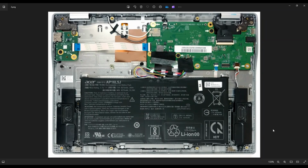Also, before I touch anything in a computer, I'm going to remove or at least unplug the battery to make it safer to work on. I'll show you how to do that now. So to get your battery out here, there's a screw hole here and a screw hole here. I imagine most of you will have screws there. I didn't have any in my computer, so this must have been opened up prior, but there are 2 screw holes on either side. After that, your battery wires come out here, they run through here and plug into the motherboard there. It's kind of a pain in the butt.